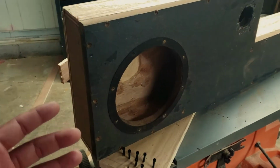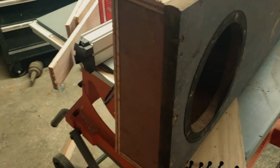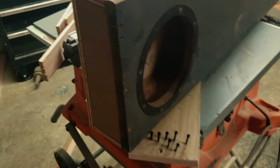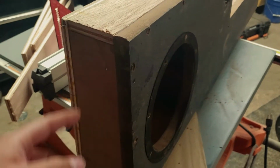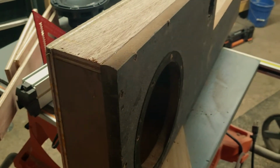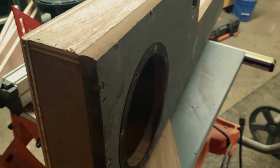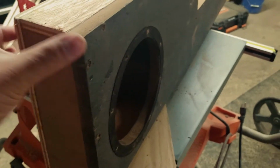The second design, I made it, I can only go, because my speaker is actually a shallow speaker, a sub. So I shaved off another 5/8 of an inch from front to back by going with a thinner back, 1/2 inch. Now my first design is all MDF. My second time around, I had some wood laying around, so I just went with the MDF in the front and 1/2 inch all around. And the side, as a bracing, I use MDF as well. So I'm hoping I can get away with 1/2 inch ply on the back and the sides, or top and bottom. But the sides, I use it to reinforce everything. So hopefully I can get away with plywood.